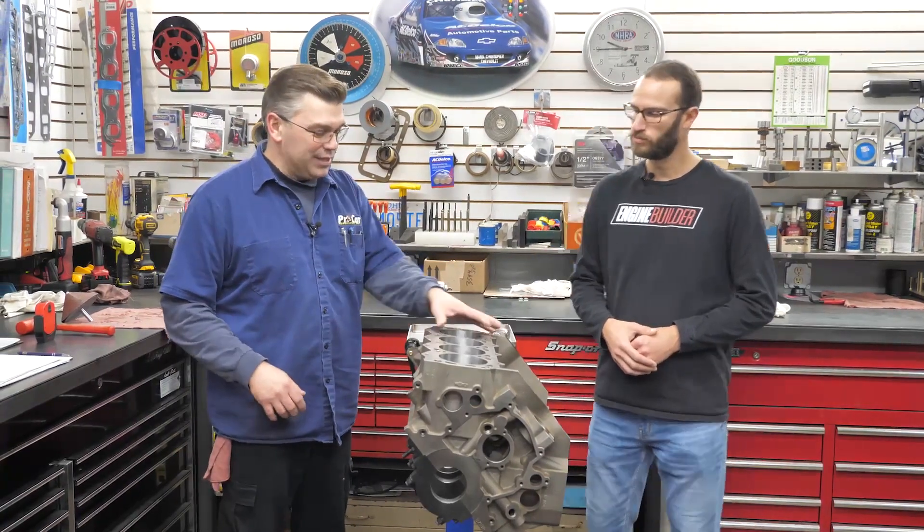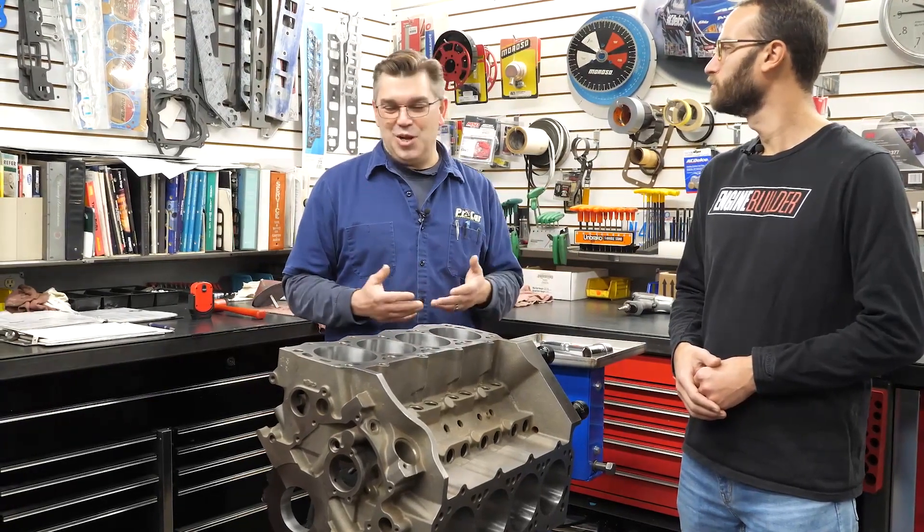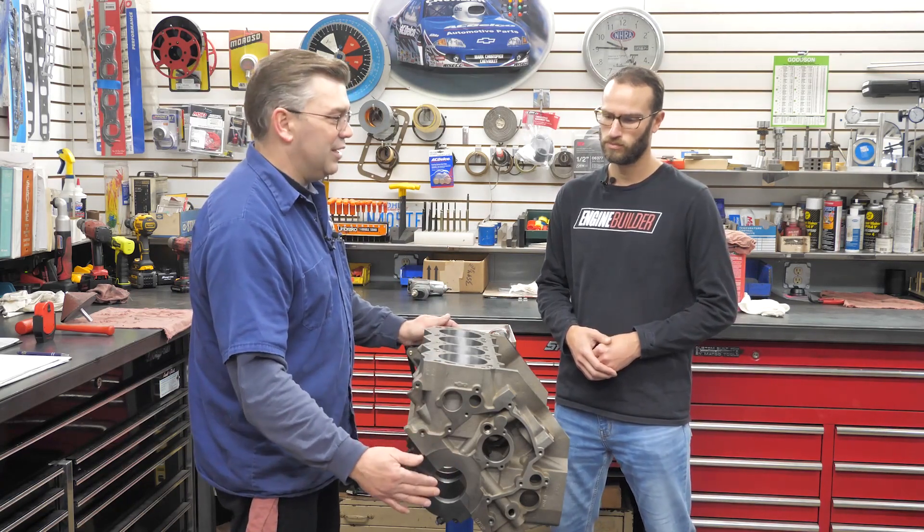The only thing we'd typically do is just a little bit of deburring, which I kind of already did before I sent it out to get machined. Now what I'll do is break this edge on here. After I clean this block all up, I will do some checks on it — double check the machine work and double check the piston-to-wall clearance. We've got all the gauges here to check everything because, as good as machine shops are, you've got to do your due diligence and not make assumptions. Just like checking bearing clearance on your mains — we check the line bore on the mains too. You always want to check all these things, even on a brand new block. You can't assume anything.